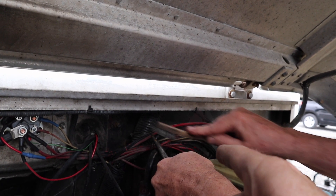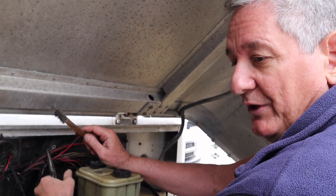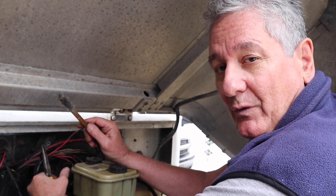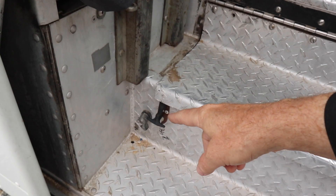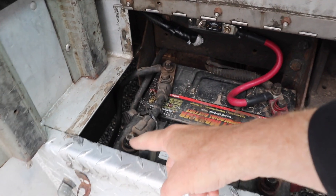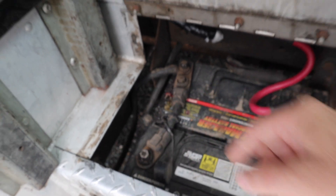The nuts are not spinning off the way they should, which is a bit of a challenge. One important safety note: there's a battery disconnect switch inside the van. With that off, there's no live battery power here, so we can't short anything out and cause a fire. You definitely don't want to be doing this kind of work unless you've disconnected the terminals or disconnected live power. I have a master cutoff switch right at the batteries — it's currently in the off position, which disconnects the negative terminal. You can see that switch connects directly here, so you can easily turn off all power to the step van.